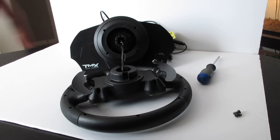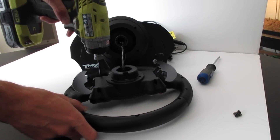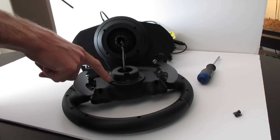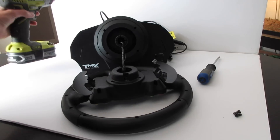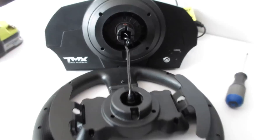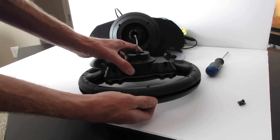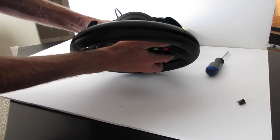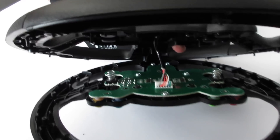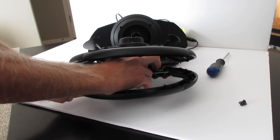Got all the rim screws out. Now we work on the four on each corner, two more here, and the last three which are deep inside — you'll really need a screwdriver skinny enough to fit in there because the screws are about an inch deep. Once all those are loosened, the wheel will basically separate. Be gentle so screws don't go flying. You'll see the plug inside — unplug it carefully, it pulls straight out.